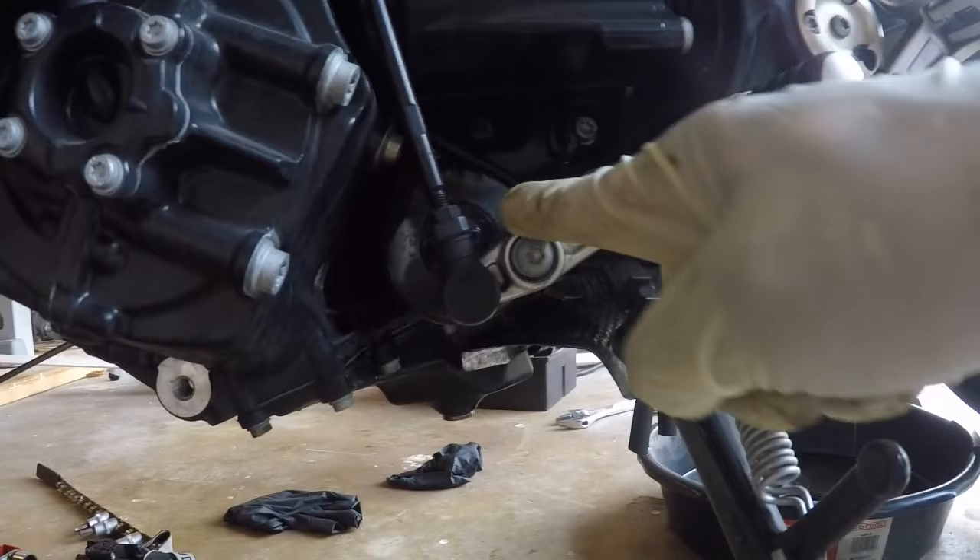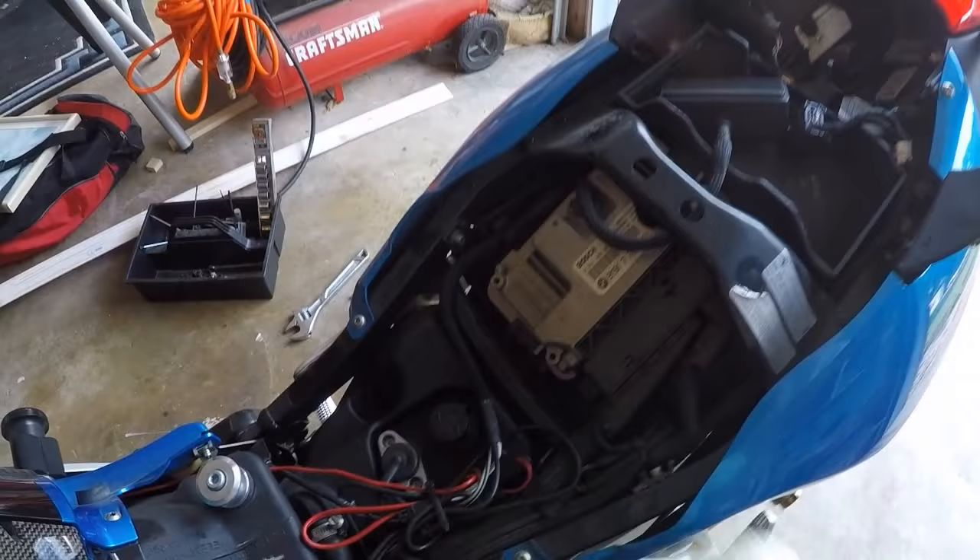Because it's BMW, everything's opposite. So you have your oil filter here — that's where you'll remove it. And as you come up, this is where you'll fill the oil. So that's how you'll properly do that. When we come back, I'll show you how to take off the other parts once this oil comes off. We're going to take off this heat shield for the exhaust.